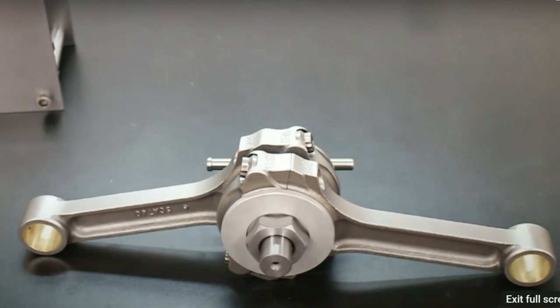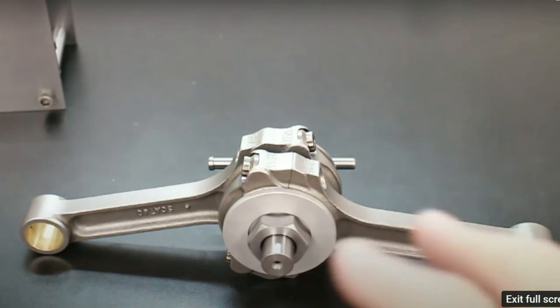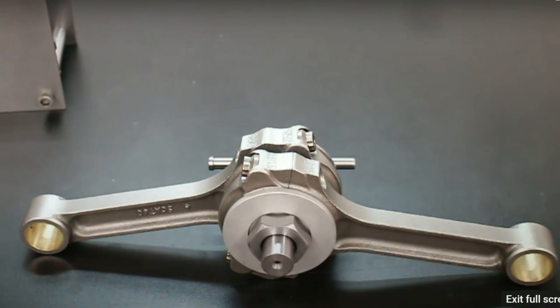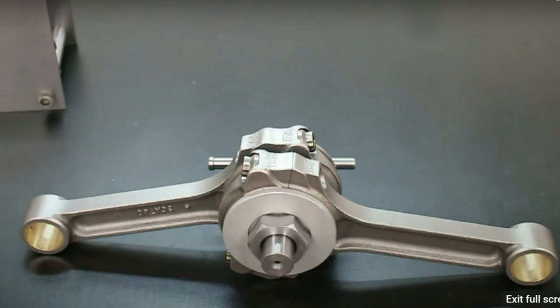Here's your first move. Locate the rods on the large diameter mandrel. Place that on the bench like this and let the rods droop down. Put on the washer and tighten the nut. The mandrel size is slightly smaller than the bore of the rod, so that's not what's holding them. There's about a thousandth clearance. It's this washer here and that nut which clamps them, right?